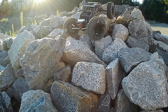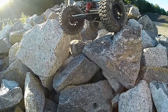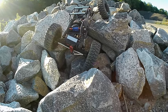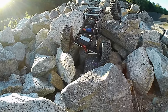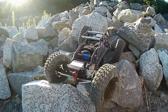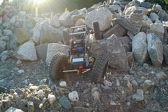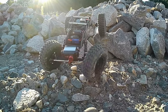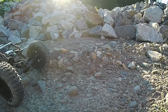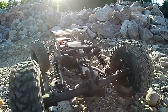I still think those builds lack the proper geometry for good ground clearance in the middle. So I took the complete opposite route — I decided to make this a belly dragger. I took the original long springs off the shocks and put some short springs on there. You can see they actually gap out a little, but that allows the shock to completely compress and gives the axle the ability to float around like it needs to in order to get up and over stuff more easily.